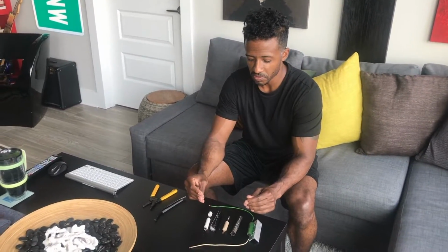Now, if you have fans that work and your resistors are bad, you're not getting your low-speed fans cut on, I would definitely get this Amazon resistor and just put this in line and save myself $100 something. If you want to do everything, then that's you in your pocket.